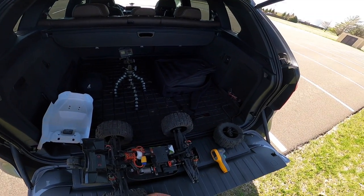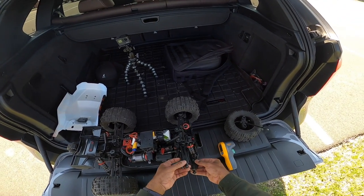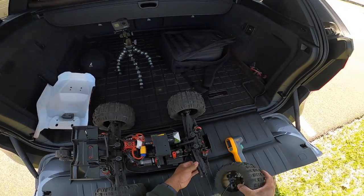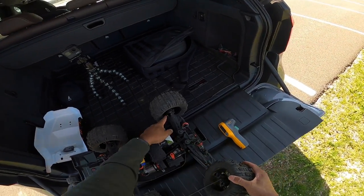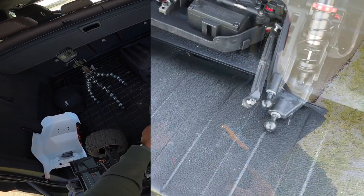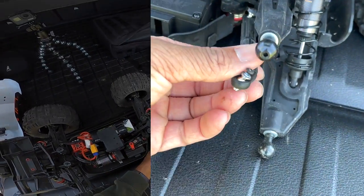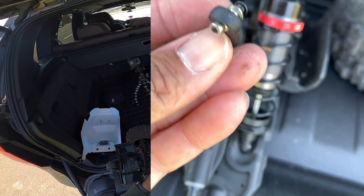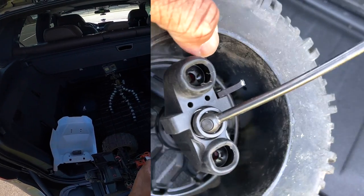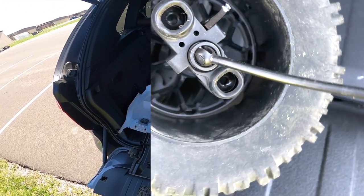All right, we'll take a few pictures of the wreck, see what we got here. The arms and the steering link are intact. I see what we're missing — I don't know if you can see it on cam; if not, I'll take some photos. I see what broke — that seems to be easy. We just got to get those back in there. This steering linkage is bent — got a little bend right here. Wheel's still good. Got some minor surgery to do with the Jambo. Let's shut it down.